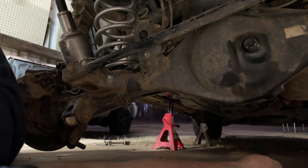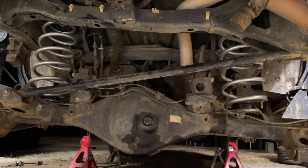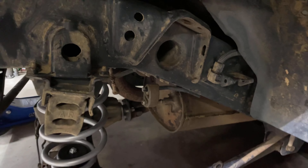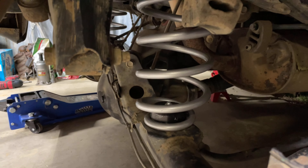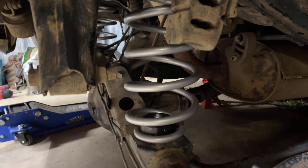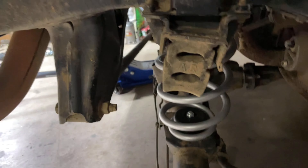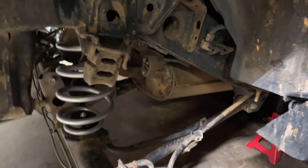Should be pretty easy to do if you have a helper. If not, you can use a bottle jack — it's just not the safest. And that's what it should look like. Once you get both of these springs in, then you're going to reconnect. I'm going to use the new sway bar links like I showed you in this other video. I'm going to reconnect our sway bar, put our new shock in, and connect it back at the bottom. Zip it all tight, and you have successfully put in a coil conversion from air suspension on a GX470. This will also work on the Sequoia — it's a little bit different, I guess I'll do a video on that as well. Some people run a different bump stop just for more travel. I'm going to leave this bump stop for now and see how it does with this lift — this Eibach system. Let's get this thing buttoned up and see what it looks like.